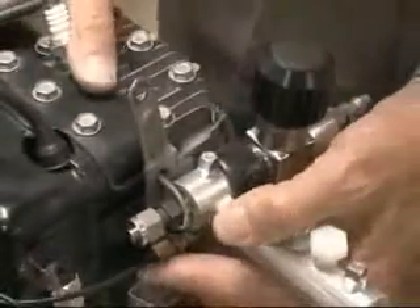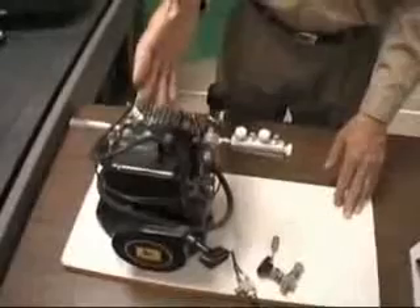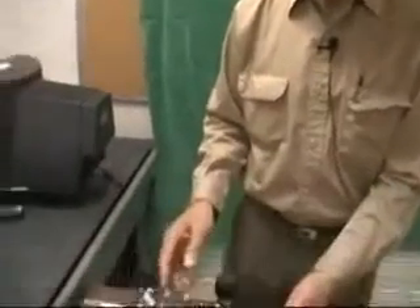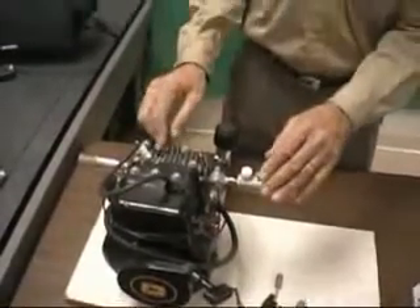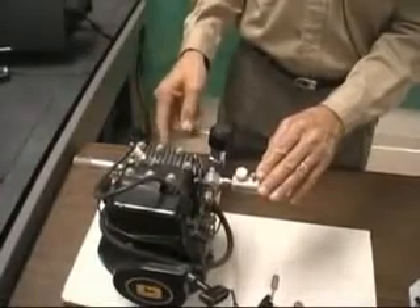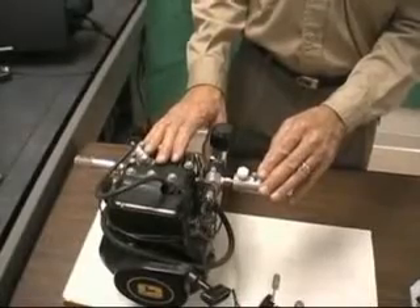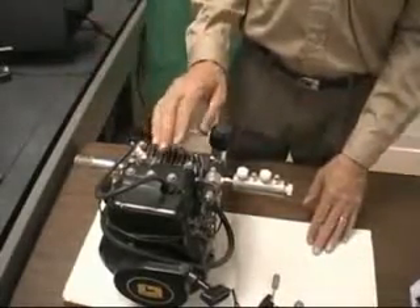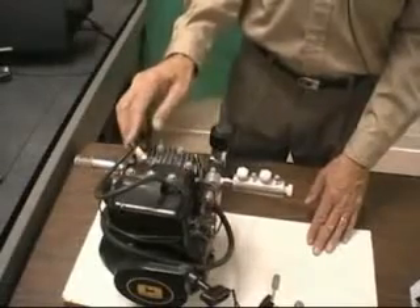You can also do your own timing on an engine such as this one by removing the flywheel, removing the key that sets it for the gasoline setting, and then relocating that key for a later ignition. You can then either use a half key for the offset, some fraction thereof, or you can mill a new slot for your new setting for hydrogen. It's a quick conversion, though it is internal to the engine. The other alternative is to change the magneto timing electronically.